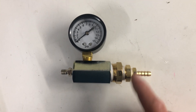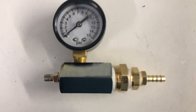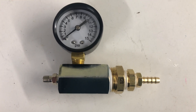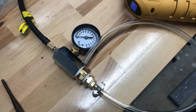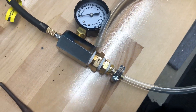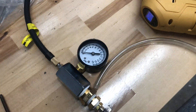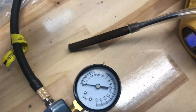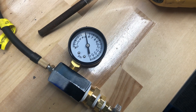Altogether that was about twenty-five bucks for a nice Schrader valve to a hose valve. I'm gonna give it a try and test it first on just a tube with a bolt in it, just to make sure it's actually holding pressure before I test it on the engine. I have it hooked up to this cheap little hose from Walmart, hose clamped on this side, and I'll just punch a hole into the hose and pump it up to about five pounds to see if it stays there.